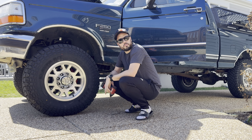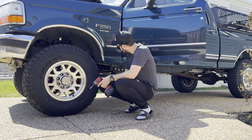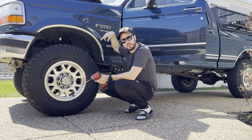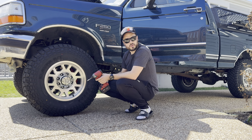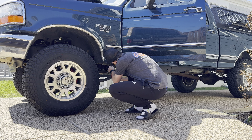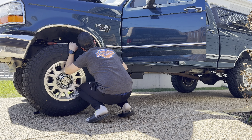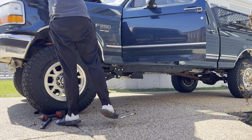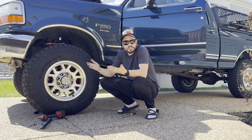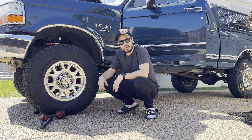Just three nuts and that's out. You can see the back of our PCM there. In order to pull the PCM out the easy way, we're going to remove this inner fender. I already got the top bolt and the middle harness bolt disconnected, so we'll pull this fender back and get the PCM out. Pulling that fender is no easy job — it's still stuck in there — but we'll get it out. We'll see how it goes.